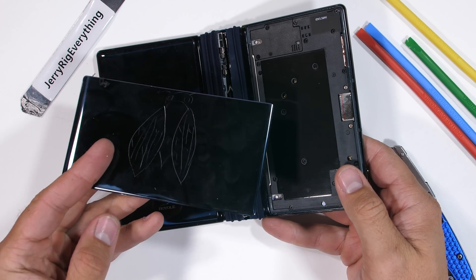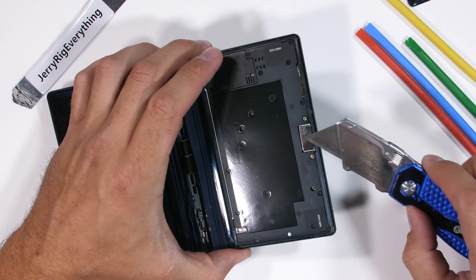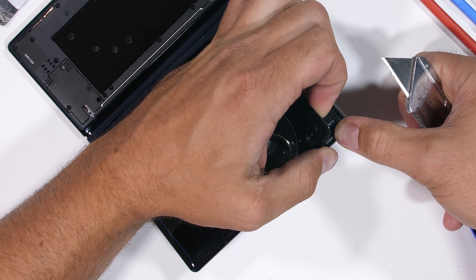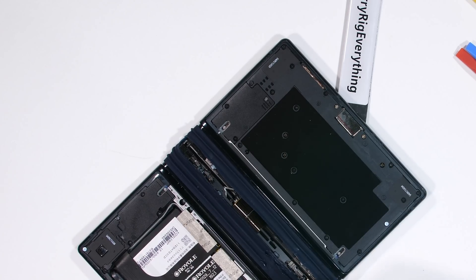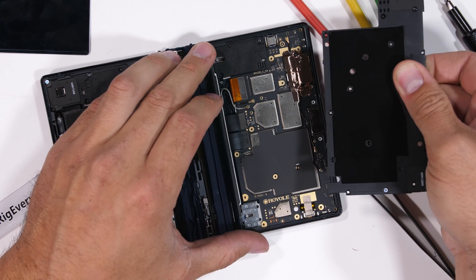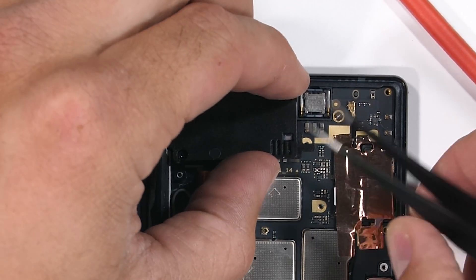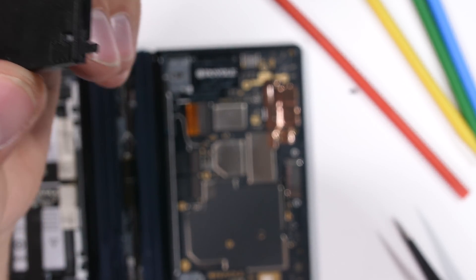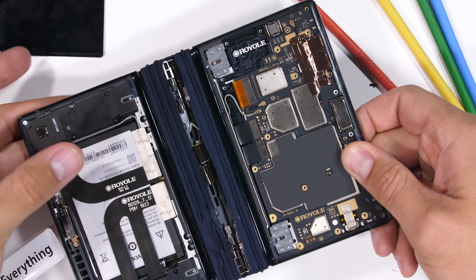I can peel off the second panel. The nice thing about plastic panels — just like we saw on the Samsung Galaxy A50 — is that they don't shatter and they come off really easy. They can also be awesomely colored, just like glass can. Plastic can now have all the perks of glass without the fragility. With both panels removed, we get a glimpse of the 33 Phillips head screws holding the whole phone together. Once those are off, I can lift off the large plastic panel, revealing the Royole-branded motherboard with a loudspeaker in the upper left corner. Most companies don't bother branding the internal frame or motherboard since nobody usually sees it — but it's definitely paid off for them in this video. It's hard to forget the name of a company when it's plastered everywhere.